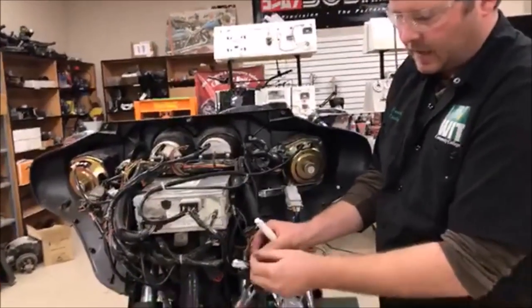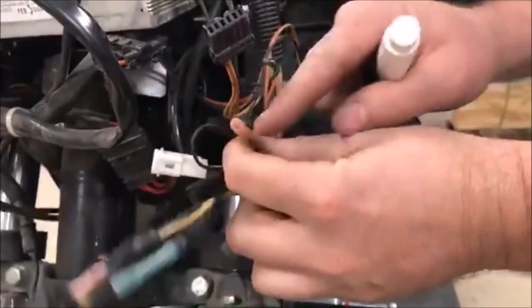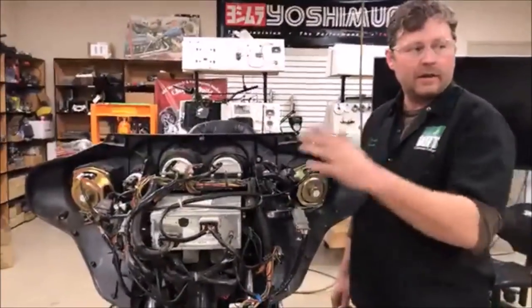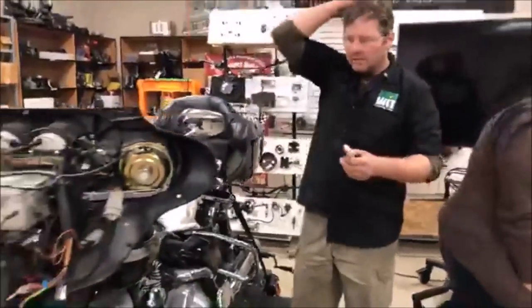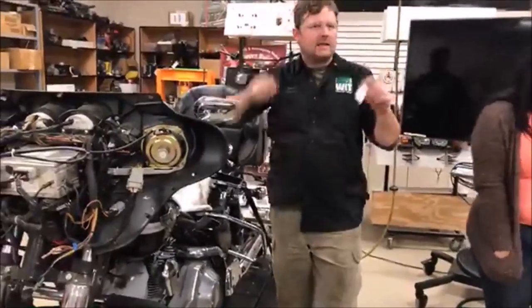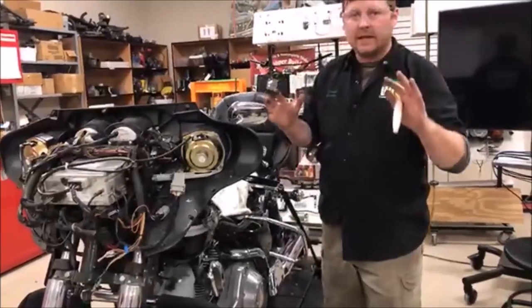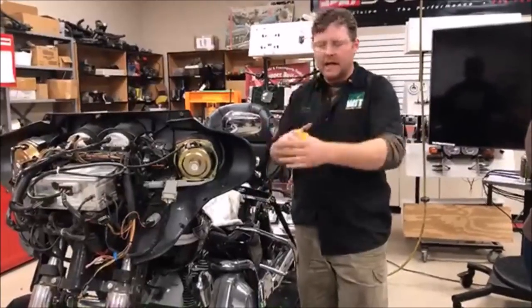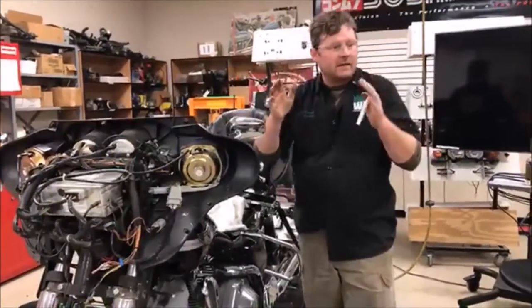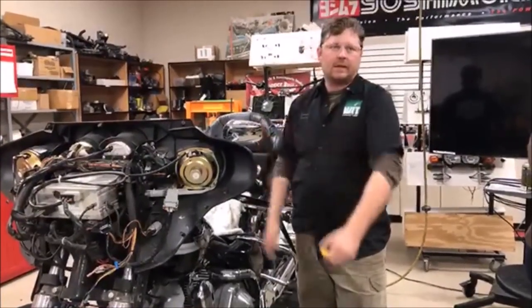Another thing I found in here — what I think is probably a hot wire that's just clipped off and exposed. That could bounce against something and cause a direct short, blowing fuses — absolutely unnecessary. So I've still got a lot of work. All we're doing is going in and being a mechanic, and you see how easy it is to find all these little things that are incorrect. Every mechanic should know this: fix all the easy stuff, route it right, tie it right, mark things, good connections. The rest of the job is significantly easier because you won't run into those big hiccups.